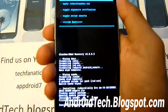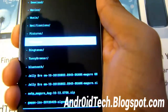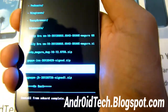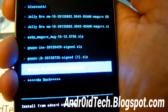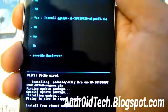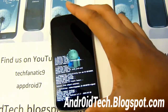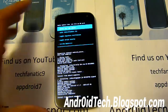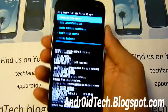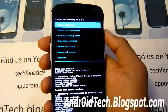Now we're going to choose zip from SD card once again and find GApps Jelly Bean — it's right there. Select it and select yes. This will be much quicker because it's a much smaller zip file. That's done. Now go back and select reboot system now.